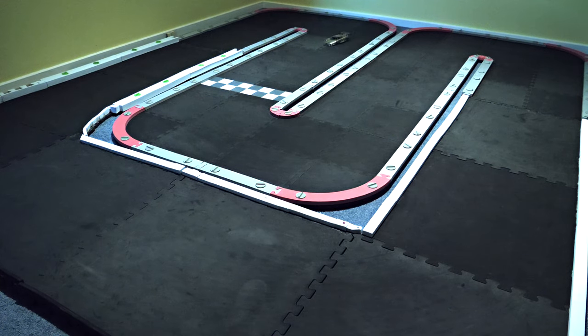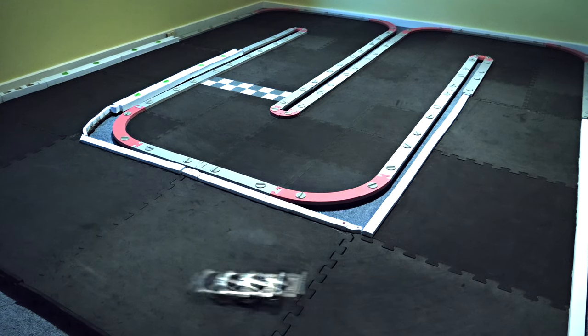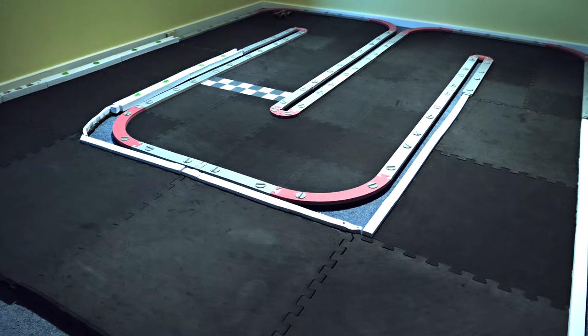Yeah, it's still doing the wheel hop, which I'd say is probably due to the one and a half offset. But I think by the time I put the McLaren's offset wheels on it, it will probably fix the wheel hop. This chassis had good turn in — it's currently working on the McLaren — but I'm going to change the front to the McLaren's offset, which I think is two and a half, whereas currently it's one and a half, and we'll just see how it goes.